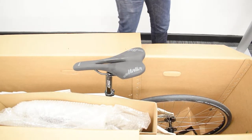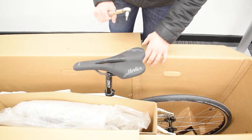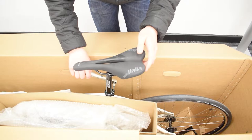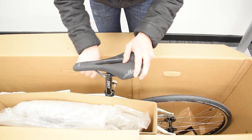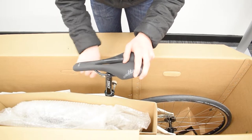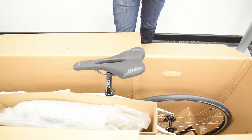To make sure that's secure in the frame, take your torque wrench and tighten that up to 6 newton meters, as that's the maximum setting for the seat clamp. There we go — the rear seat post is now nice and secure in our track tandem.